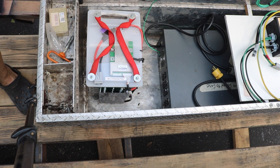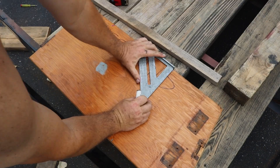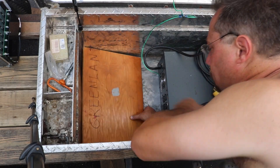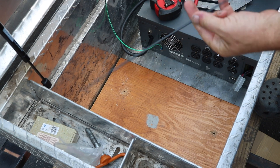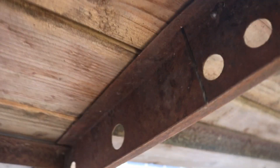Then I would be able to use some wood screws to mount down the battery to that piece of wood. I made some marks on a recycled piece of lumber and cut it to length. Then I just popped it right down into the battery box and drilled some eighth inch holes, and I left that long bit poking through so I could find it from the bottom. Down under the trailer - sure enough, easy to spot right there because we've got the bit sticking through, and it looks like that came out in a pretty good spot.